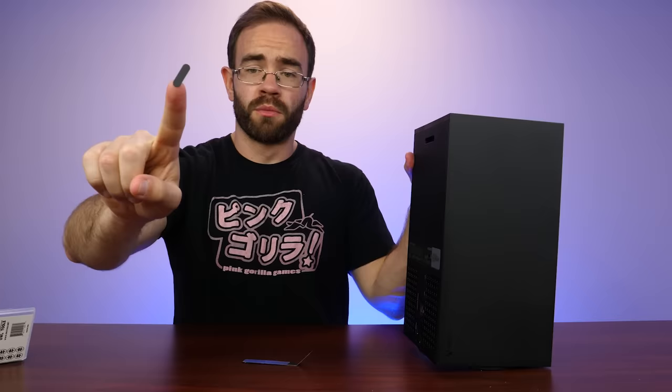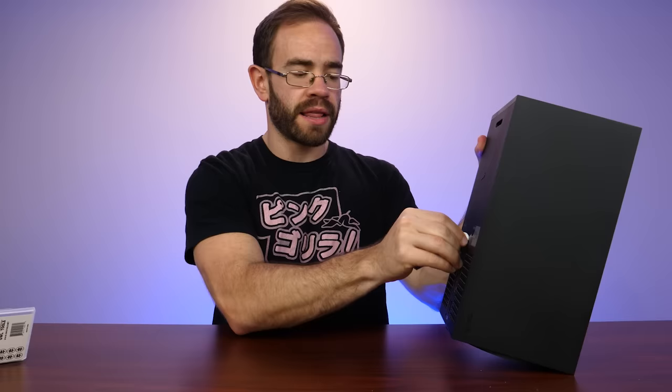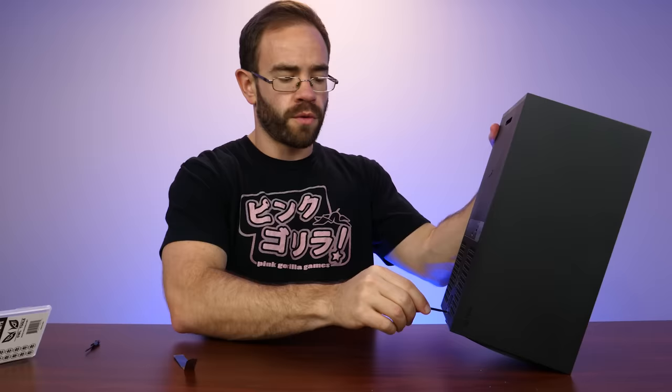We have one warranty pad sticker off. I'm just going to attach it right to the top there so we don't lose it. And then I have to unscrew right in here — I might just be able to cut away at the sticker around it. We can measure up very quickly which one this is. It's probably either a T10 or a T8, as that's usually what they like to use for these systems from Microsoft. Looks like the T8 fits very snug, so we'll go with that one.